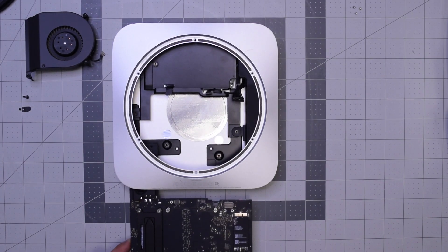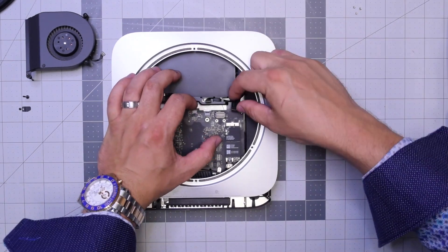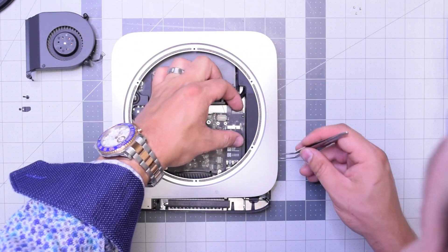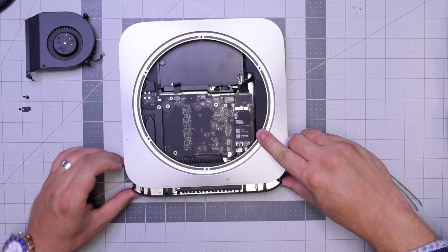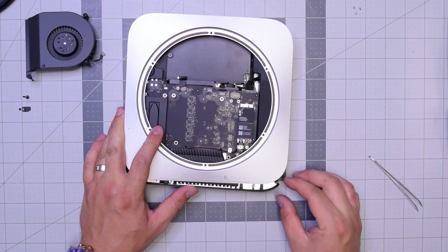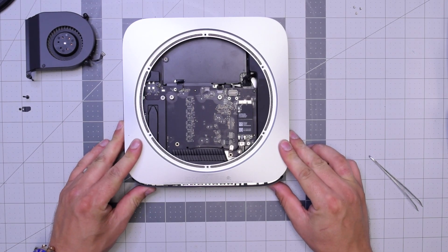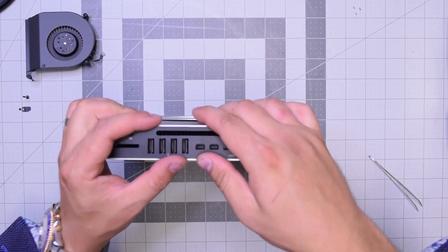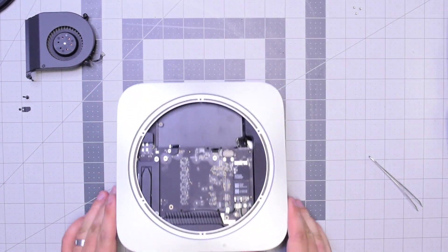Let's reinstall the logic board. Go ahead and slide it in in the following orientation. Don't push it in all the way — make sure you have enough slack to plug in that power cable from the power supply. This should take some playing around but you should be able to align it. Push it in and make sure it's all the way in. Push the clips in on the sides and make sure to push the logic board in all the way once you've got the power cable hooked up. You might feel some resistance — you might have to pick the case up a little bit and then push it in where you feel the resistance.